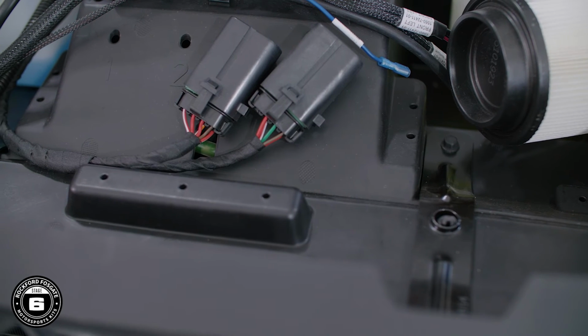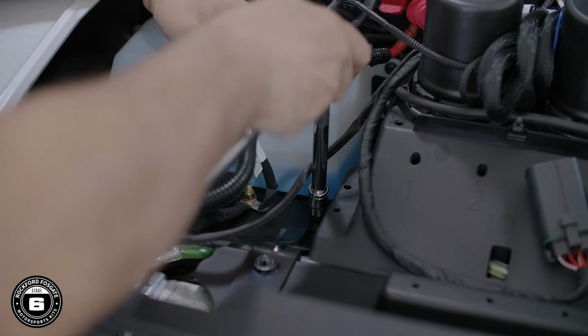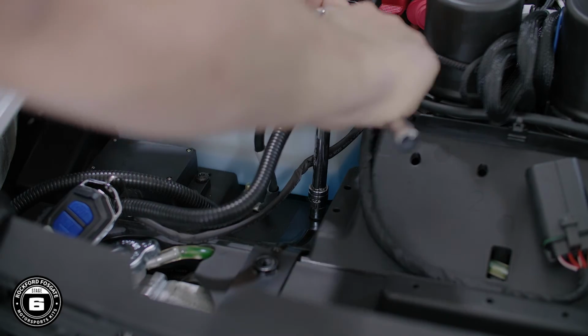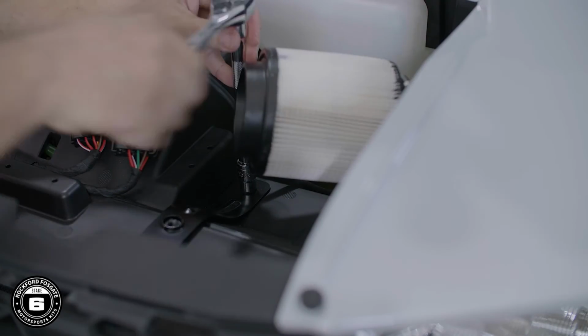The amplifier mounting bracket uses the existing mounting holes and alignment standoffs used by the support brackets located in the front hood compartment. Use the 10mm socket to remove the 2 back bolts holding the bracket in and a T40 Torx to remove the 2 front bolts.